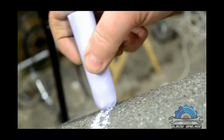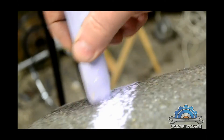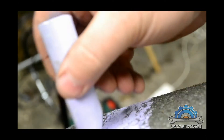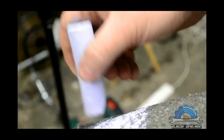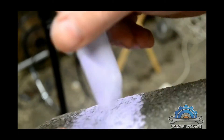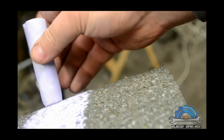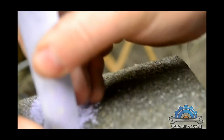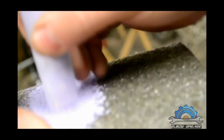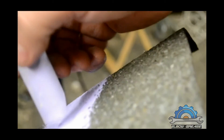After honing, when your engine is running for at least around a thousand miles, follow specific break-in procedures — don't rev up or do redlining. You have to keep your engine at quite low RPMs, probably up to 2500, no more. What's going to happen is these two surfaces will grind together to create smoother contact.